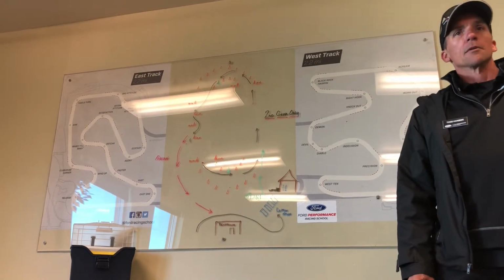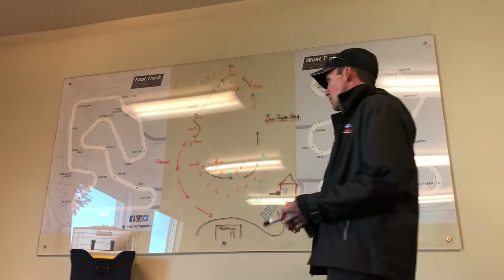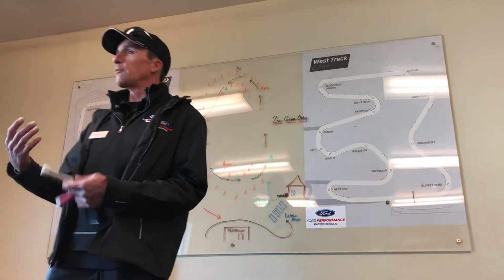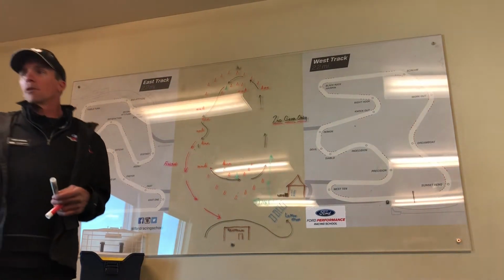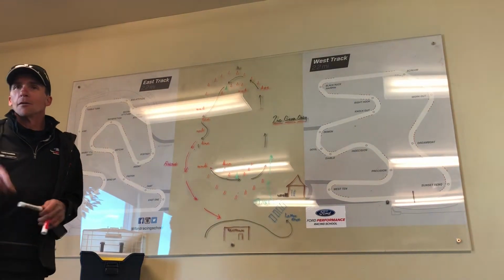But it's different ones, right? Correct. To keep it up, right? Yes. But the way it works is that the fluid has little tiny metallic particles in it, and when you charge that, it will stiffen the fluid up, which makes the car stiffer. Okay, so that's how it works. That's what's happening when you push the button.